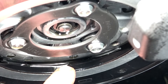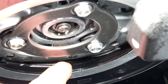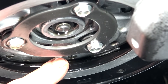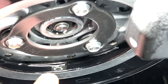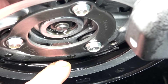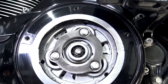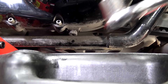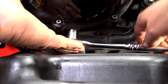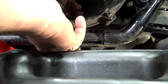When you're filling this back up, make sure your fluids are right at the bottom of the pressure plate. If you overfill it you're going to have issues; if you don't get enough in there you'll have issues too. It's not rocket science — a tad too much or too low is fine — but getting the fluid up onto the pressure plate will cause it to slip. Fill right to the bottom of that plate. Now the camera goes straight down underneath — that bolt right in the middle is your primary drain using the same 5/8. Back it off and let it drain.